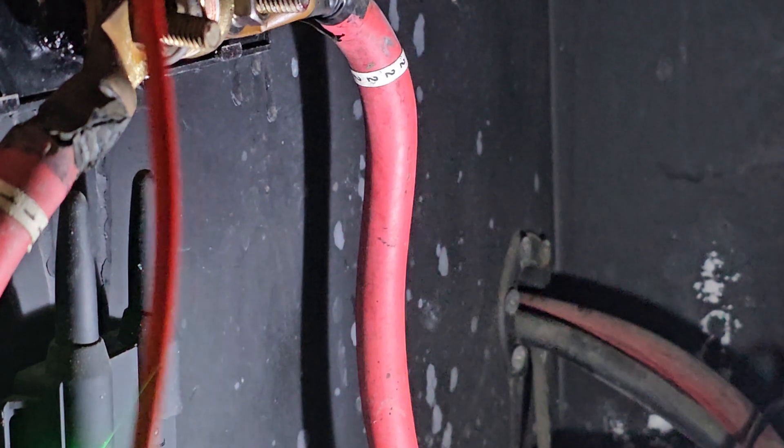13.5 on one side, 12.4 on the other side of the fuse — folks, we blew a big fuse. That's why it's not pulling many amps. That is a 250 amp fuse. And there is a lot of heat on it — we could fry some chicken on that. Remember: amperage creates heat.